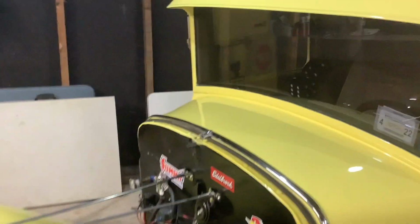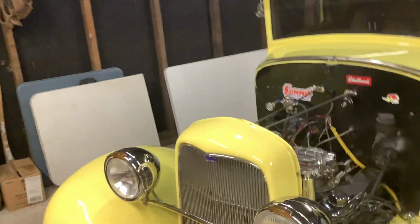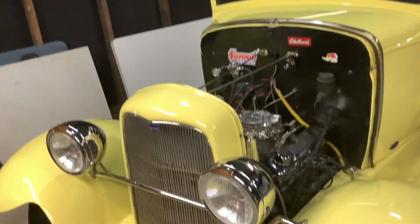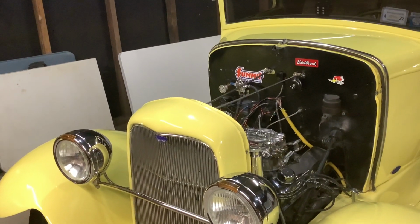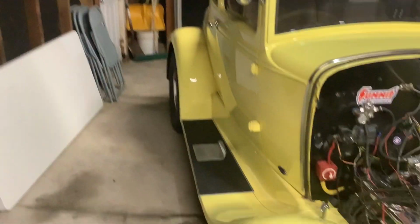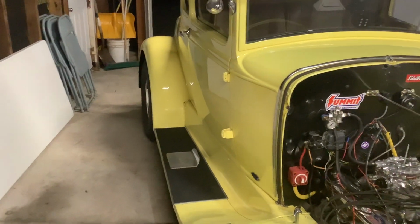I'm going to try to thicken it by putting it out and letting it dry down a little bit, and then work it with a small, very fine tip brush, and dab those in over 4 or 5 coats, and then get them built up, and then maybe I can rub it down with a little bit of compound in that area. Just maybe. We'll see what happens. Just want to kind of fill those in so we don't lose any more paint in that area. I was going to say rust, but those are fiberglass fenders. It'll kind of hold it together.